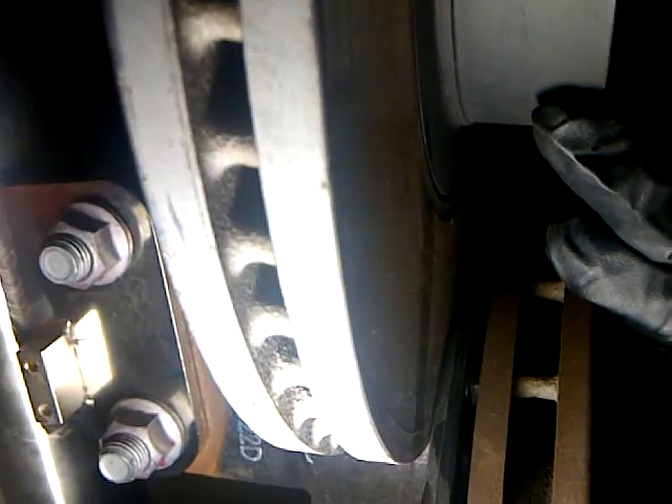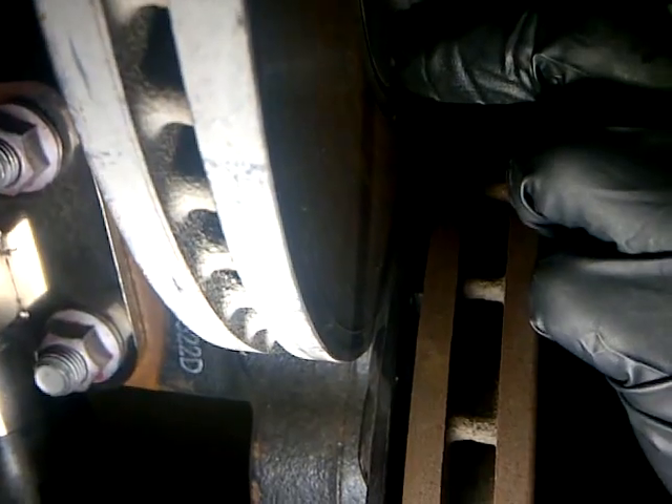You can see not nearly as big an air gap, and just those standard straight vanes versus what you see here — much, much larger air gap, directional venting. Big difference. And we believe that this brake upgrade is one of the first things you should do if you're going to spend any time on the autocross or even just casual track days.